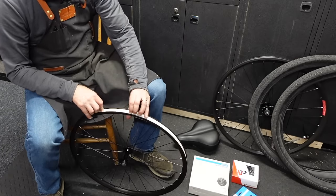So I'm gonna trim that cable quick. Grab a cable tip. Give her a crimp. Okay, so I can already feel that the cable is pretty loose. So we're gonna grab the cable, loosen the anchor, pull, tighten her back down. Whoa! Hey, thank God we have the spoke protector on there. Look at that. Dork disc to the rescue.